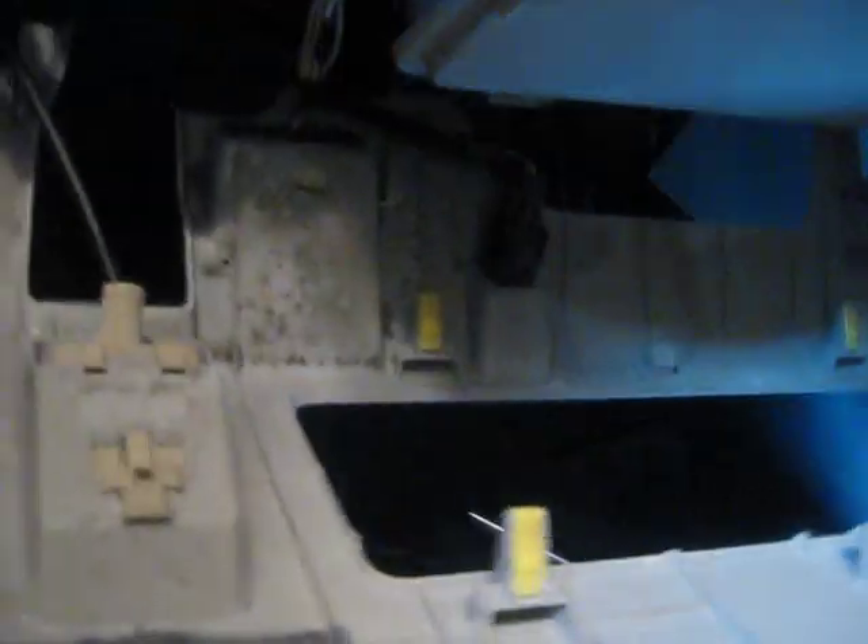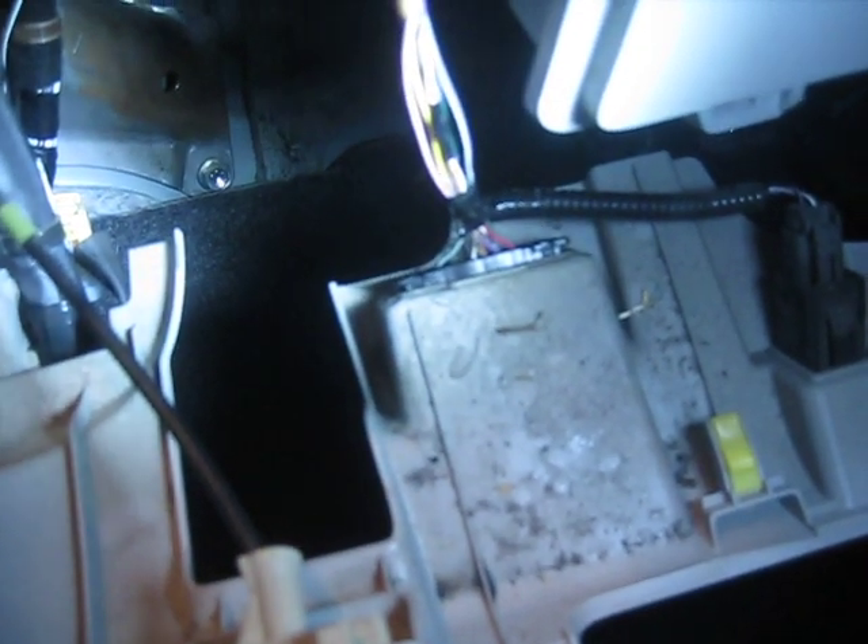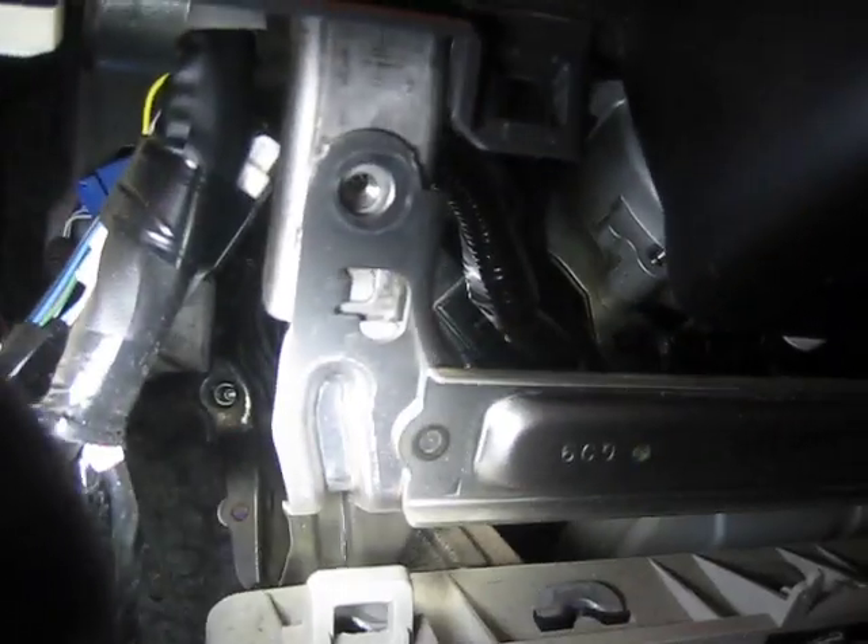The hood pop release was just going to slide out. You've got your throttle position sensor stuff over here — it's just a little clip that will pop out. And your OBD2 port, which is also just popped out. I did take off my airbag, but I guess you don't have to. If you want to, there's one bolt, then one, two, and one down in the corner, and the thing just lifts off and hangs.